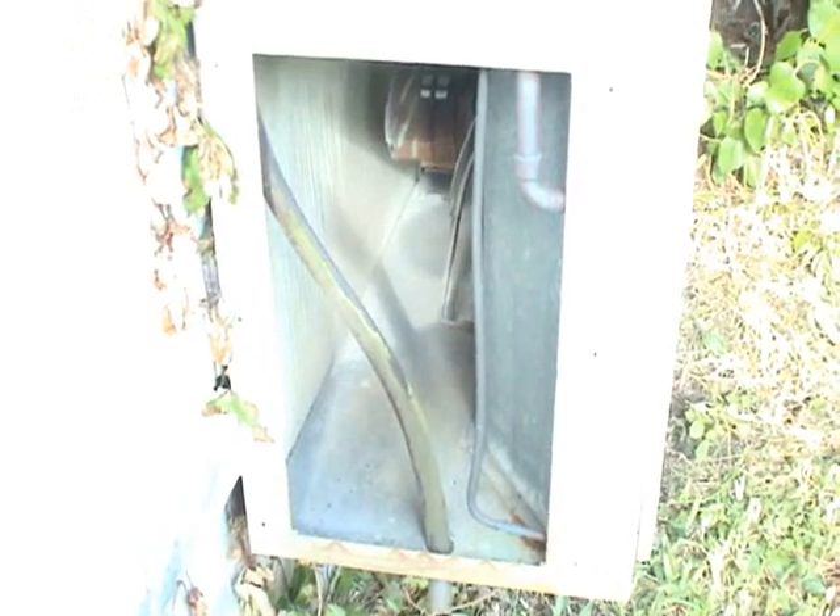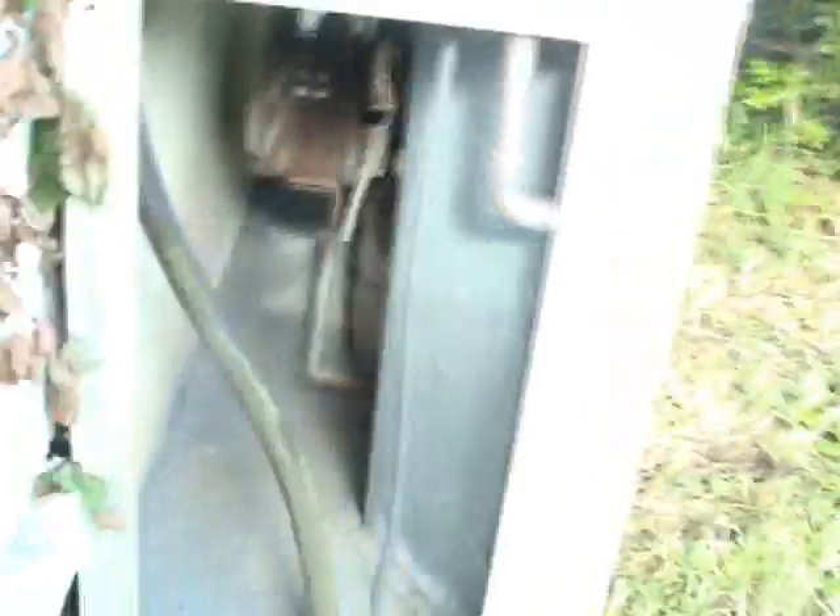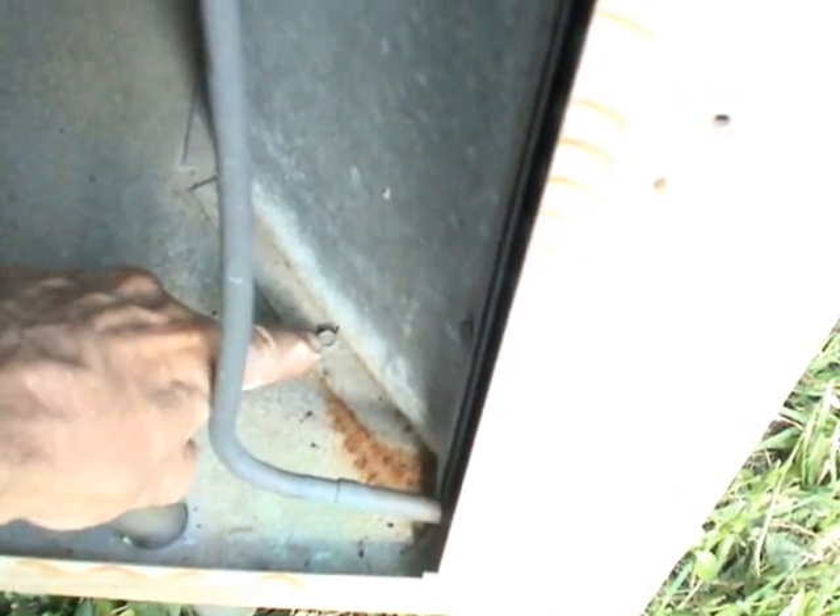What I have to do is pull the condensing fan motor out of there. The way I do it is I actually pull out this entire shroud and everything - this whole metal piece right here. It holds the fan motor in place and I'm going to take the whole thing out by removing all the screws that hold it in place. I'm going to do that now off camera.